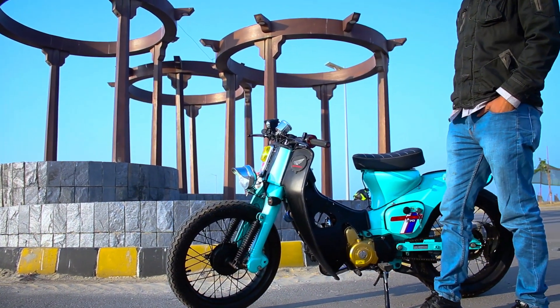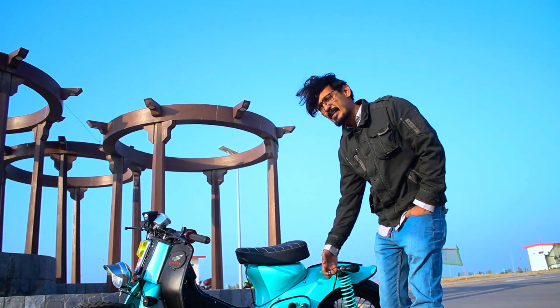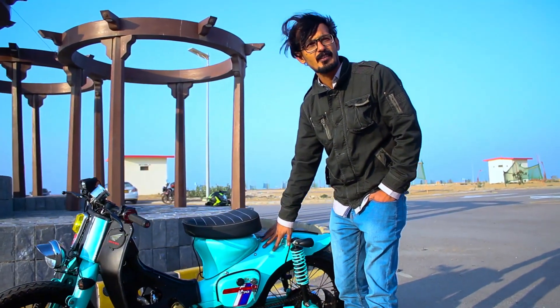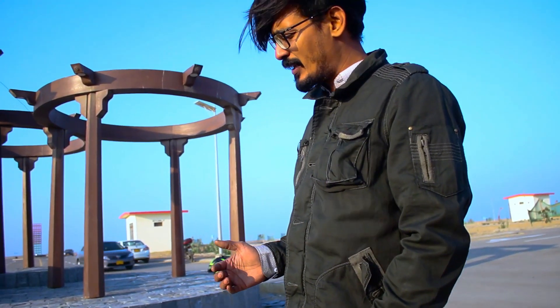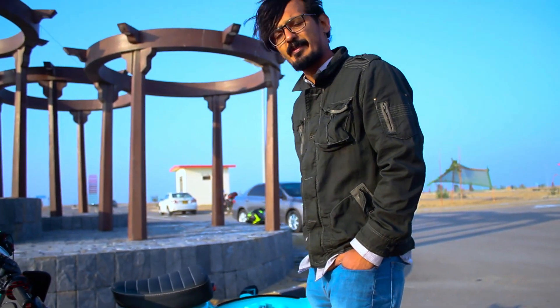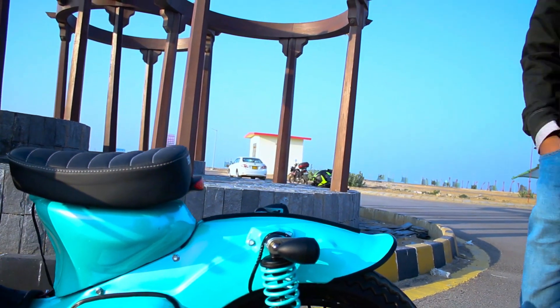The engine is not stock. After modification, there are heavier tires on it and the bodywork is a little heavy — the plates are big. In the original 50, the shift gears are very limited, so I had to upgrade it to 110cc. So this is a 110cc engine upgrade — big engine.